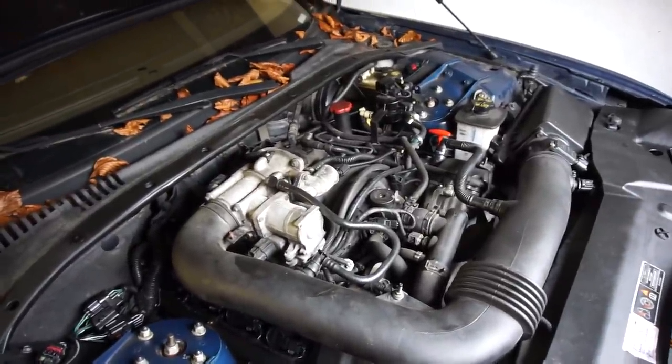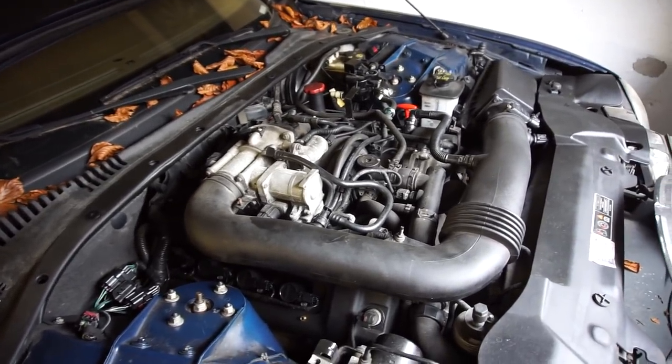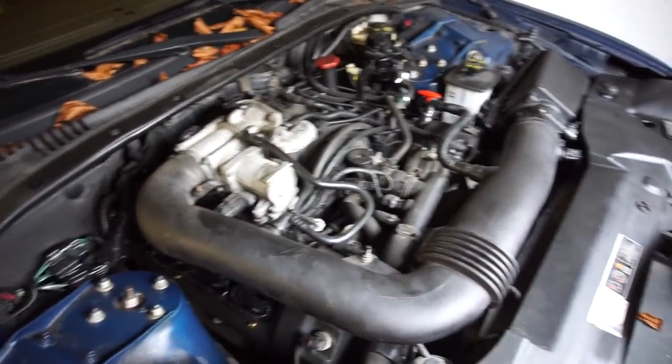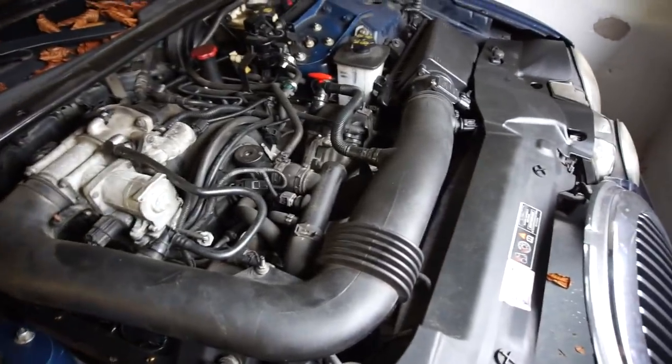And hopefully it's going to lift in here pretty easily. I've checked in the manual and it seems to be that the easiest way to do it is to leave the transmission in the car. So undo the bell housing bolts and, you know, a bunch of hoses, a bunch of connections. It's lots of steps, lots of things have to get out of the way.